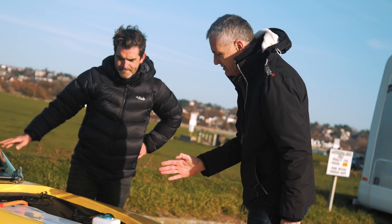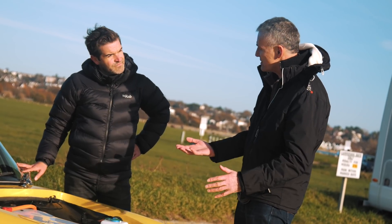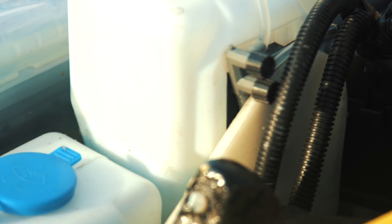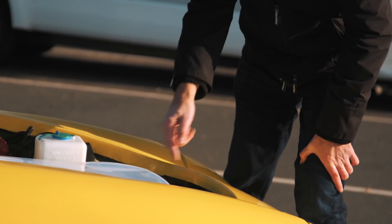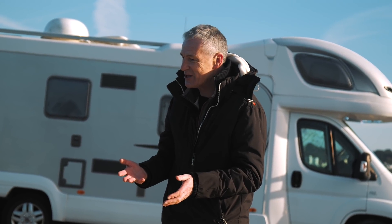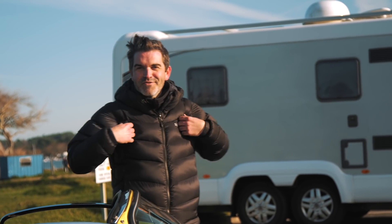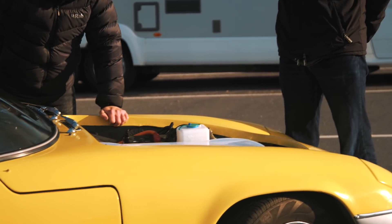The key thing about the Tesla batteries is that they have water channels running all the way through, rather than LG packs which tend to be pouches with just water cooling on the bottom. That's one of the reasons why they're very effective. So you've got water running all the way through the back battery pack and the front battery pack. In the summer it needs to be cooled by the radiator, which is off a Formula Ford — super lightweight. And in winter they actually need to be heated up because they don't work very well in the cold. It's all packed in absolutely beautifully with no space wasted.